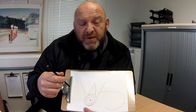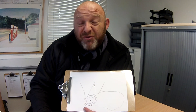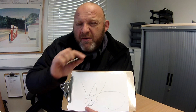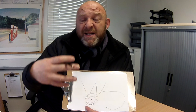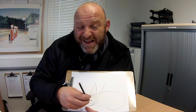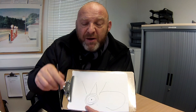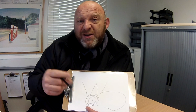However, as soon as you start revving the engine and riding along, then you'll have more produced. Therefore it will amply supply the battery — or charge the battery, I should say — as well. So there you have it, that is the alternator. It's located on the left-hand side, enclosed within the primary case of the engine. It is driven by the crankshaft, which drives the rotor containing the magnets around the coil, around the windings. And that creates an electromagnetic induction, which creates the alternating current. And then the voltage — these peaks and troughs — that's all sent to the voltage regulator for changing.